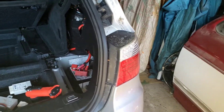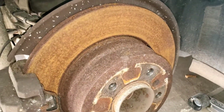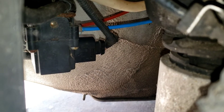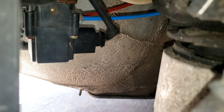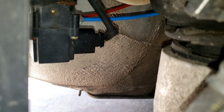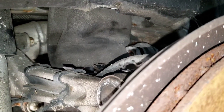I only found a few little sources and it was really kind of difficult to piece everything together, but it's actually really simple. I took off my wheel just to get visible access. Back here, you can see this whole black block with the red and blue going into it and a plug going into it too. That is an electronic controlled valve that has the pressure feeding in the back, and then it feeds out the red and the blue for the right and the left. You have to open up that valve to get pressure to your airbags to be able to manually pump them up with an air compressor or otherwise.